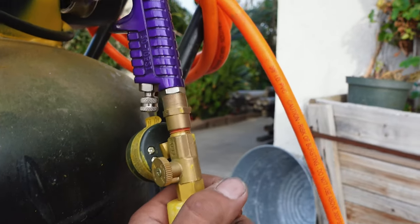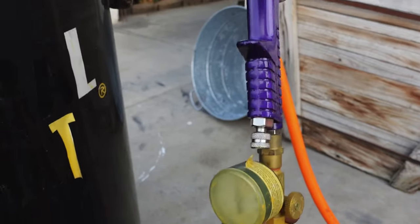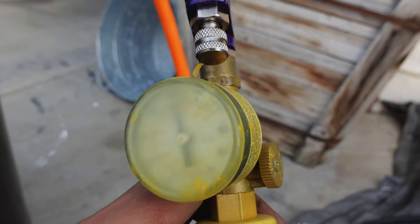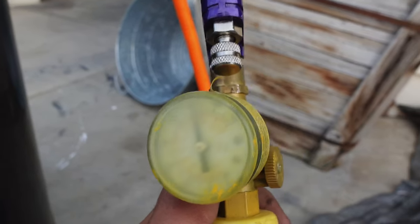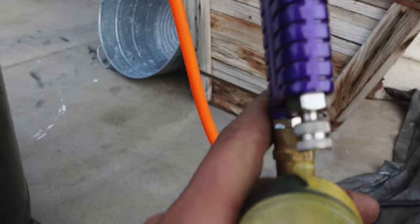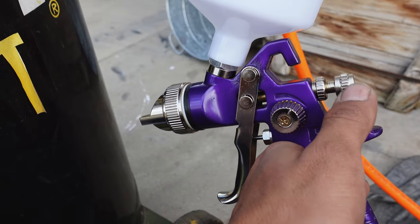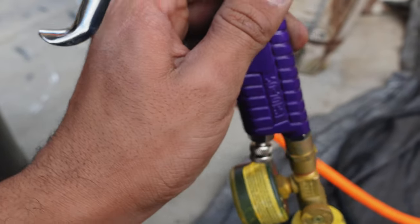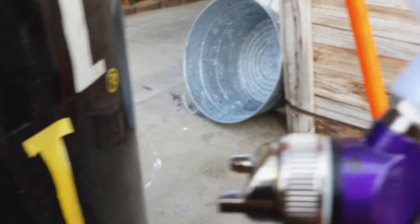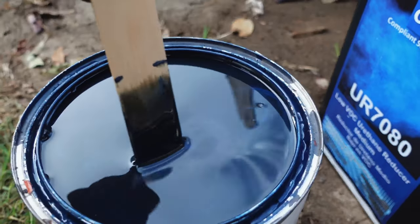A little trick I like to do is put acetone in the gun before I put the paint, that way I can see how the spray pattern looks. I think I'm going to start off at about 40 PSI. Right now the gun is receiving about 120 PSI but the regulator when you hold it down it drops to 40. I'll start at 40 PSI, six inches away from the work piece, and go from there. Look at how much metal flake there is.